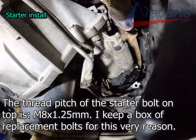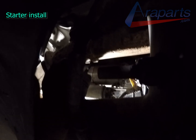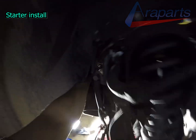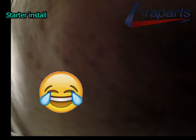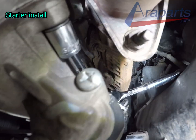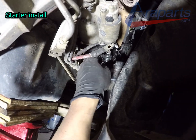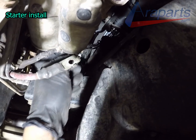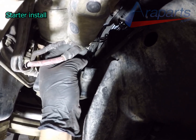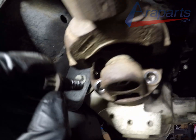I found another missing bolt — it's M8 by 1.25. Here is how I installed that bolt through the wheel well. I'm using a quarter-inch ratchet — it's the only combo that will get it back on, a 13mm socket on a quarter-inch drive. Once you've got that on, start putting the rest back together: your crossmember, sway bar, your axle, and everything up top. I put a little bit of red Loctite on the axle bolts, and we put it all back together.